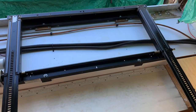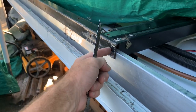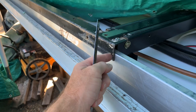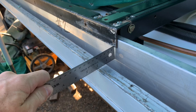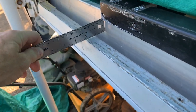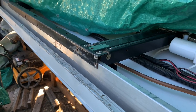When squaring up the slide-out mechanism to the outside wall, you want to make sure it's dead-on, obviously, but no more than an eighth of an inch difference between this side and that side. Right here to this edge I've got exactly two inches and exactly two inches, so I'm perfectly square on my slide-out mechanism. I'll go ahead and tighten everything up and then recheck for square.